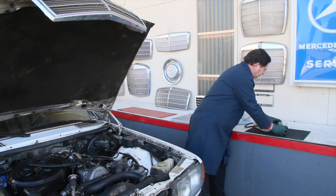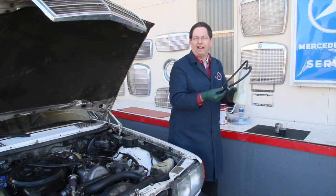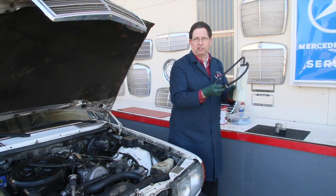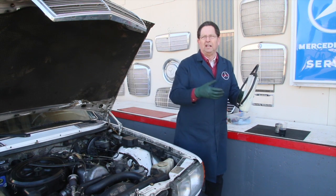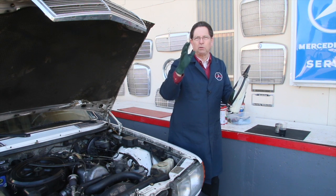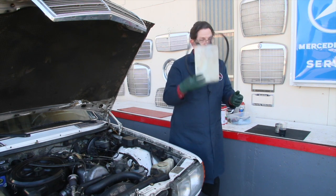Now there are a couple of things when you're doing the purge. Be sure and use the little coupling included in the kit — it's a 5/16-inch straight coupling to hook the two hoses together as soon as you unplug them from the engine, because you're going to have purge dripping all over the engine. By the way, this is a really nasty chemical and I recommend you always wear heavy-duty nitrile gloves — not just regular nitrile gloves. You don't want this stuff getting on your skin, believe me.